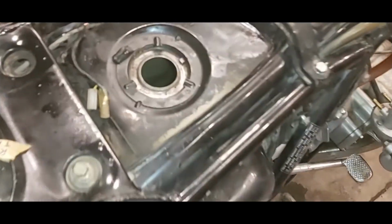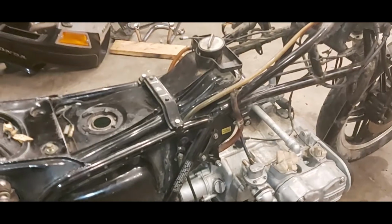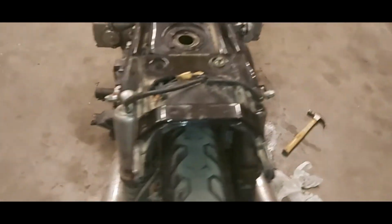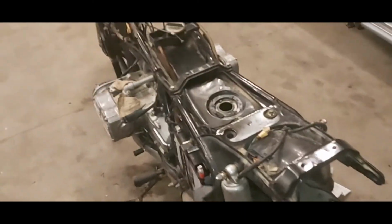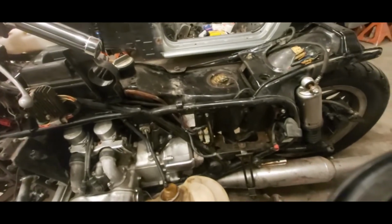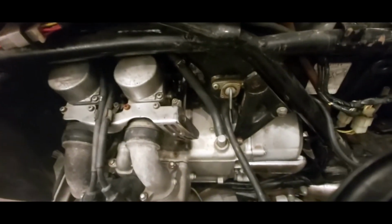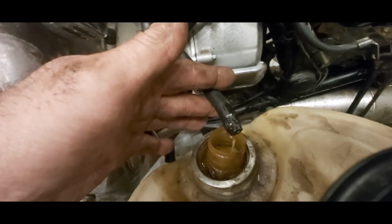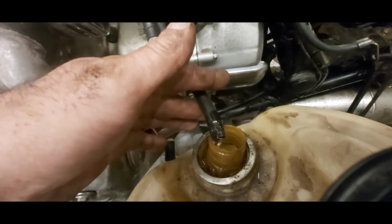All right, well, it's my next task. Get rid of that. I know you're saying, hey, pull the fuel tank out of it. And I was going to pull the fuel tank out of it, but I got lazy. Kicking crap. So, always check your basics. I thought I had the fuel drained out of this tank. Valve open. Nothing coming out. Well, whatever's left in the hose.